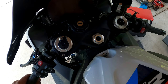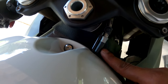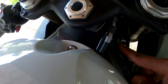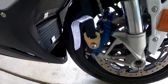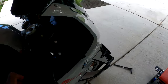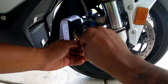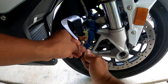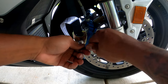Now that that's done, we get our zip ties. I wasn't exactly thrilled with the strap going over these wires and brake lines, so I ended up just routing it under the brake line and under all this stuff. If you want to do that, do that — I just didn't want it to rub on anything and possibly cause damage. So go up to the center of the bike, pull everything as tight as it'll go, and wherever these sit naturally is where you want to tighten.